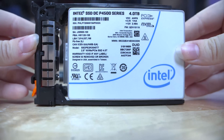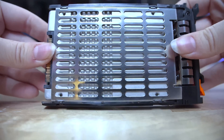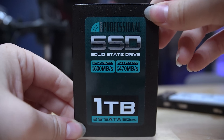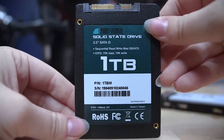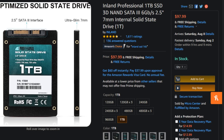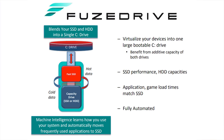For example, I've got this four-terabyte P4500 here. This will basically make everything in the P4500 about as fast as the 1.5 terabytes you have on the fuse drive. You can also fuse it to cheaper SSDs like these Inland SSDs — which I recently reviewed with the SK Hynix — a SATA SSD. SATA tops out at about 550 megabytes per second, and these are only about a hundred dollars each — one terabyte, two, four terabytes — something inexpensive bulk storage. And this thing will figure out what data is hot.